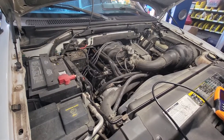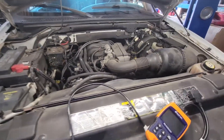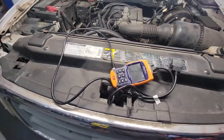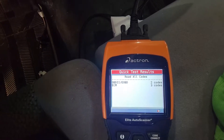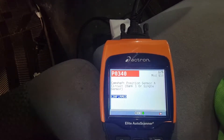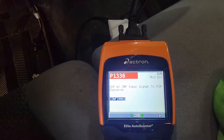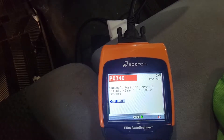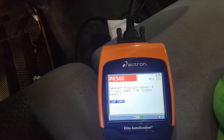I don't see a fuel port on it so I can't really check the fuel pressure, but I haven't really checked the codes either. So I broke out the code reader to see what's going on — camshaft position sensor. There's only one on the 4.2. Camshaft position input signal to PCM concerns, so it's either unplugged or it's not reading correctly.